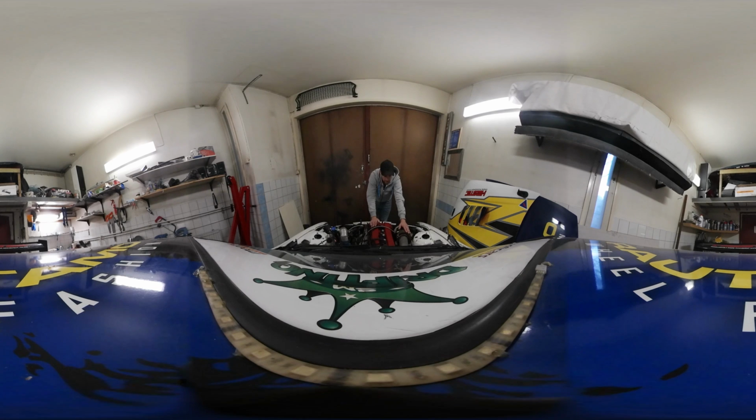The exhaust side, if I remember correctly, is 18 or 19. Exhaust manifold is from Turbo Bandit. The oil return is also from Turbo Bandit. It's a drilled hole in the oil pan below the engine, or in the side of the oil pan, and you just bolt the return line in there. Downpipe I have made myself. Wastegate is over there below and it's also from Turbo Bandit.